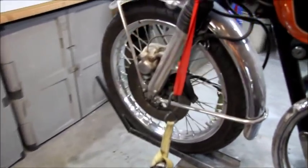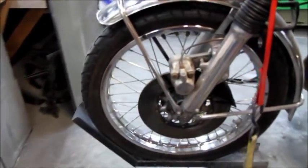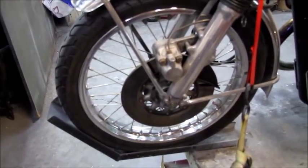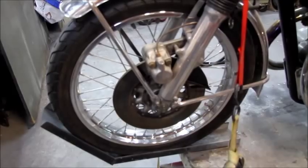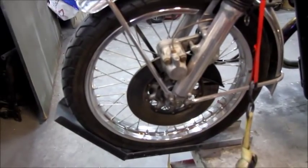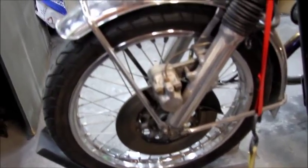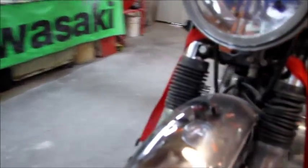About the only thing I had issues with was the front brakes — the bleed nipple was broken off, so we're going to have to get that drilled out and put a new one in so we can bleed the brakes, because I want to change the lines.